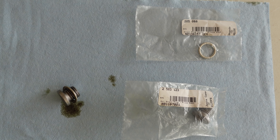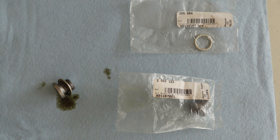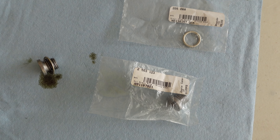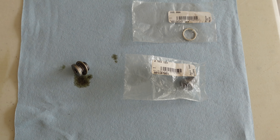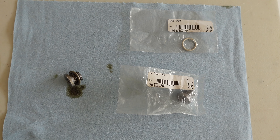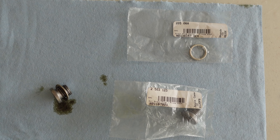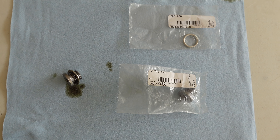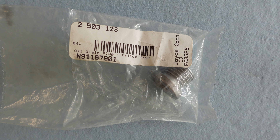Slide the new o-ring down into that bottom groove. Just take the new filter and slide it on — it fits nice and snug down in there. One key item worth mentioning: you'll see there are torque specs on the end of the cap, calling for 25 newton meters. If you don't have a torque wrench, it's not mandatory — just make sure it's snug. Reinstall the filter housing cap and get it hand tight, then torque it down. This is probably overkill but I'm going to use the torque wrench.